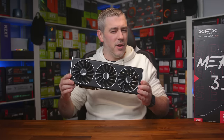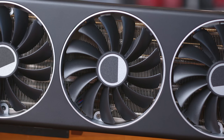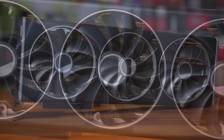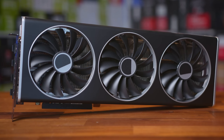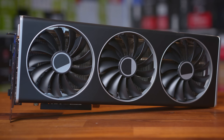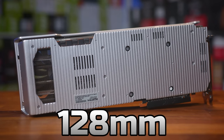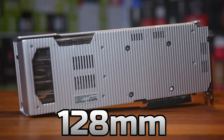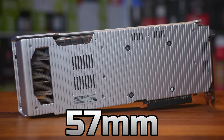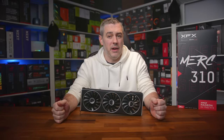That's not a bad thing. The card, as I mentioned, is large, as it has to house the three 100mm dual ball-bearing fans and the mammoth finned block and vapour chamber heatsink. The cooler looks like a beast, and hopefully it is. It puts some flagship series cards to shame, coming in at 344mm long, 128mm high including the PCI Express connector, and 57mm thick, so it will take up just under three slots in your case, which may cause some installation issues.